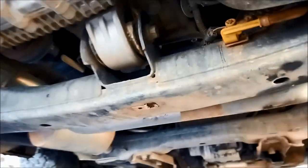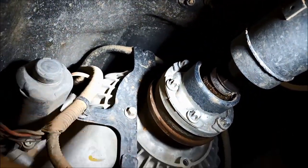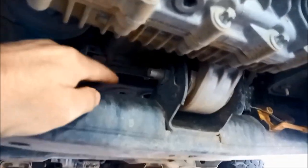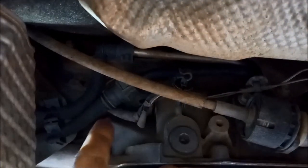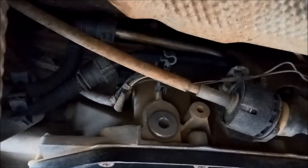To get more access you can remove these two bolts — there's one up here on this bracket too — take this bolt out, and then you can jack up the transfer case until it hits the floor, giving you a little bit more room. If you still can't get it off, you might have to take this rear cross member off and this piece of the exhaust. Over here there's also a fuel line going right past the mechatronic case connector sleeve, which we need to get out to be able to get the valve body out.